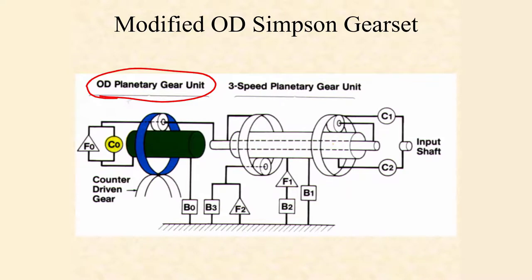When we get into a four-speed or modified gear set to give us four speeds, we have to add in the overdrive planetary gear set. That gives us a couple of other items: an overdrive clutch, an overdrive one-way clutch, and an overdrive brake — B0. This simply adds another simple planetary gear set. The intermediate shaft comes over and connects directly to an overdrive carrier, and we have an overdrive sun gear in the middle that gets held to the housing by that overdrive brake. The overdrive clutch and overdrive one-way clutch connect this carrier mechanism right to that sun gear when applied, causing them to turn together.